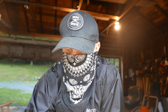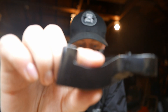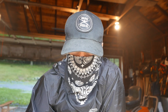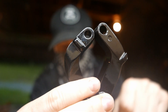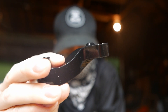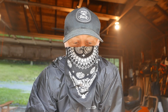So I'm going to try to change one of the mirrors to fix it, but I'm also going to try to extend it with these small extender pieces that I got from an individual on HD forums. They look really similar to the ones that come in the set for Harley Davidson's stock kit, but I don't know if they're exactly the same. There might be one issue — there's a notch here on one and then over here on the other. That might be a little bit of a problem, less so for the right one, but the left one might be more of an issue when it's trying to sit up underneath the bar.